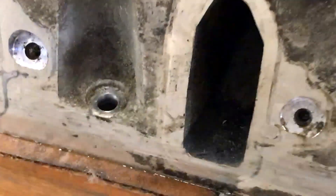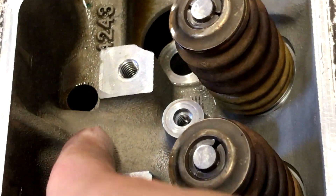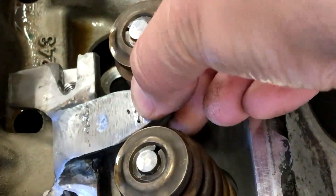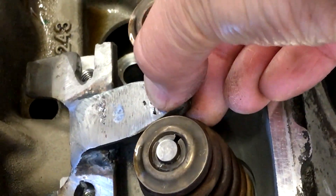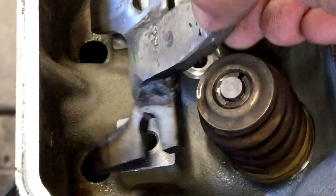The reason why this looks so goofy — this big cutout — is not needed for the cathedral style head. The cathedral port is very tall and skinny, so on the casting there's not much to clear. The pedestals sit above the head so there's plenty of room. It doesn't have to look this goofy or be an inch and a half wide like it is.